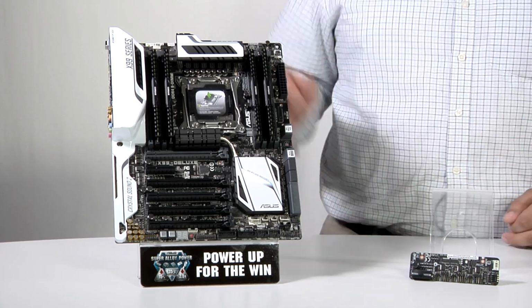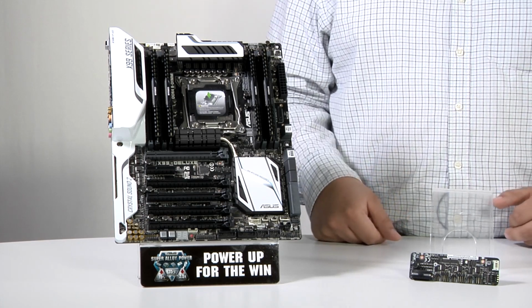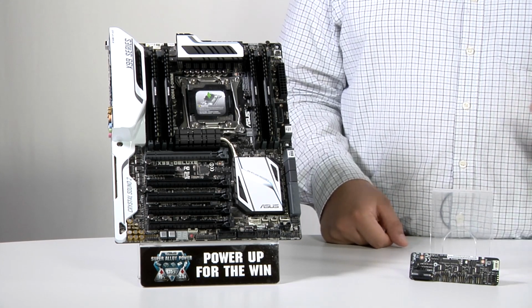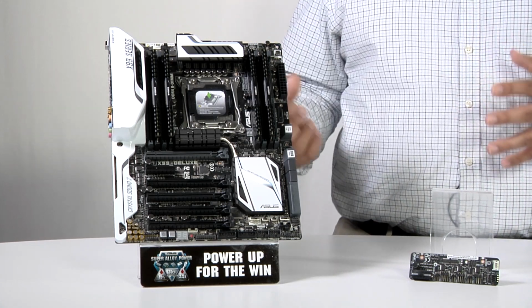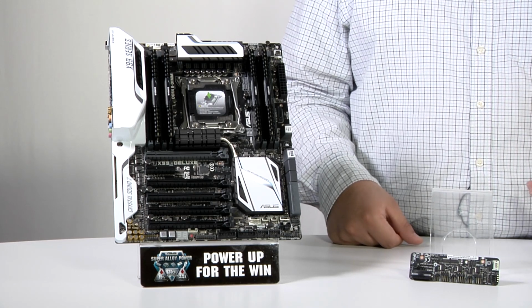on an ASUS board. This motherboard features a total of 6 onboard 4-pin headers, and they're located in great locations so that you can run them effectively to where you need to for all the associated fans in your system as well as for your CPU cooling solution. The great thing is that although they're all 4-pin based, they're fully compatible and fully controllable for both 3-pin and 4-pin.